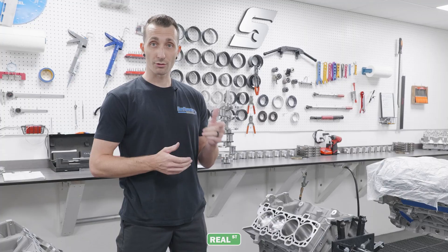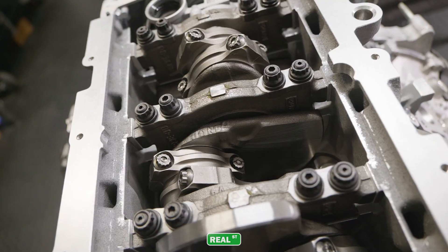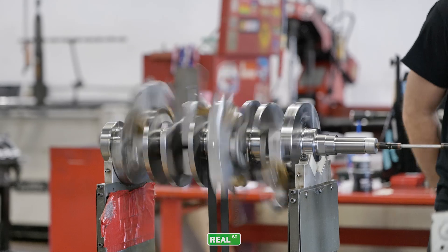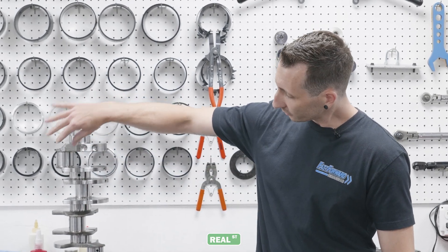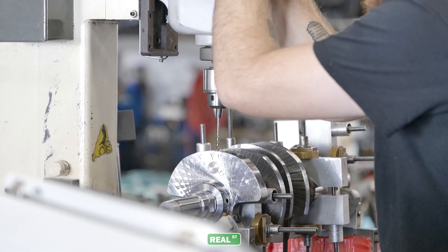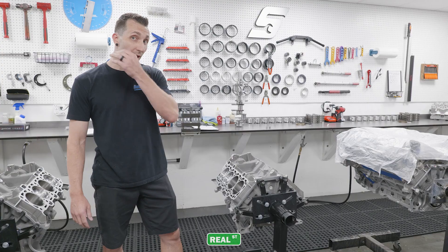The difference between Stage 2 and Stage 3 is the O-ring in the deck, which helps keep cylinder pressure in and keeps everything happy. We use stock caps on all of our builds with ARP 2000 hardware top to bottom. Here's one of our factory forged Boss crankshafts — we balance every single crankshaft to the rotating assembly for that specific engine. We put Mallory metal in almost every crankshaft to simulate the bob weight, which acts as if the piston, rod, rings, pin, locks, and bearings are all on that rod journal and spinning. This tells us exactly whether we need to add weight or drill front or back, ensuring balance within a gram from left to right, which keeps vibrations out and keeps the engine happy.